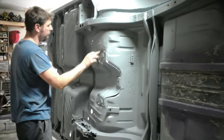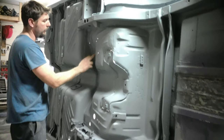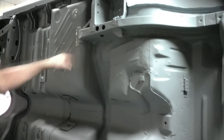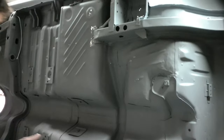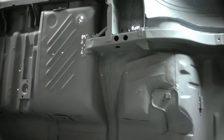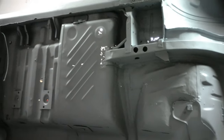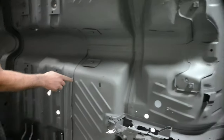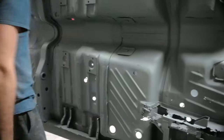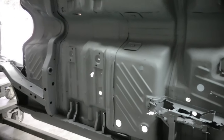You can see the patchwork on the bottom floor pan — someone cut a section in there. Between that and the rust holes in it, every corner part of this floor pan just needs work. So it's just easier at this point to put a one-piece in and do it right — it's going to look better when all is said and done. Also this floor pan, it looks like they kind of cut it and mismatched it — they just don't line up right, so we're going to fix that.